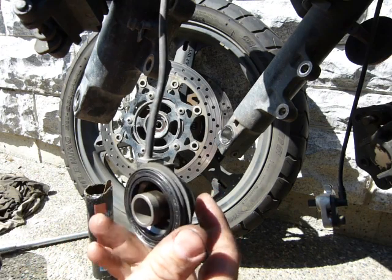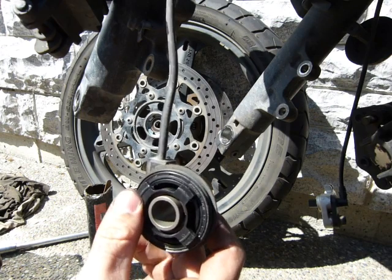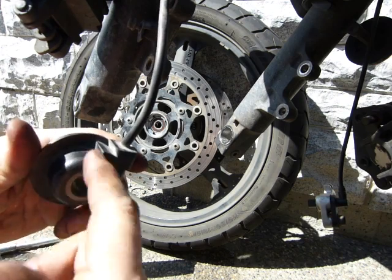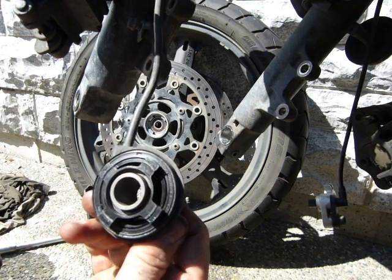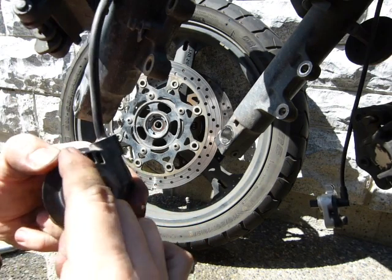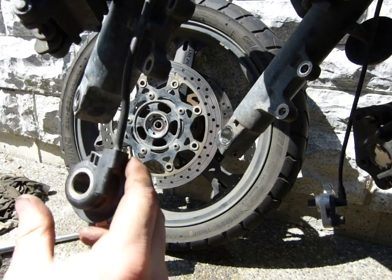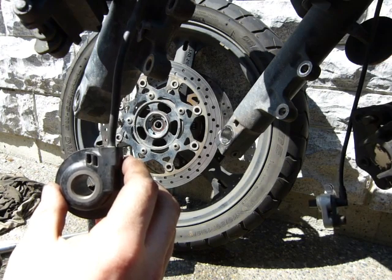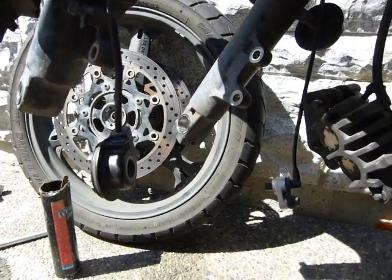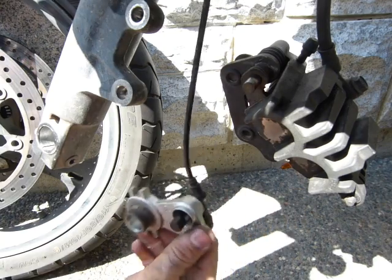Here is a piece of magnet and electricity. When a magnet is spinning, the direction of its north and south poles changes in rapid succession. That change of direction in magnetism — in a wire coil embedded in here — induces electricity. So this magnet spins, electricity in the wire coil is induced, and that sends current along the wire in a pulsating manner. That's read by the computer and translated into kilometers per hour — that's the basic principle.